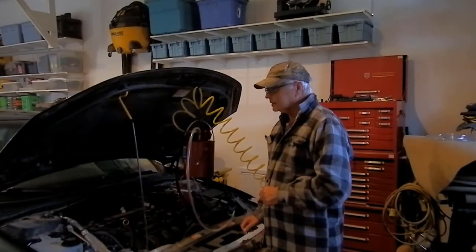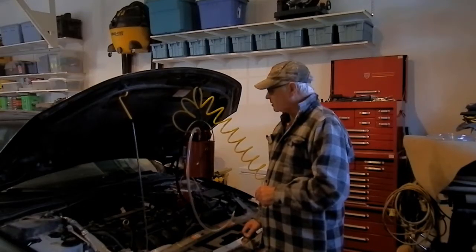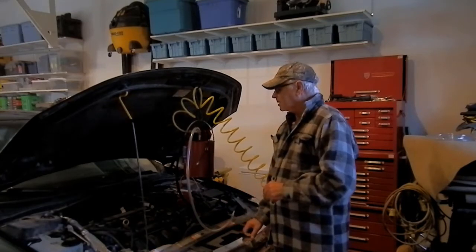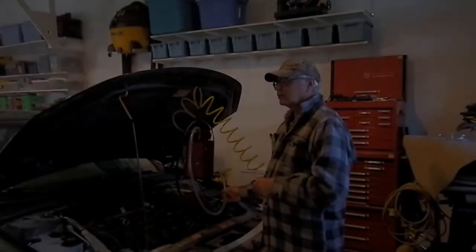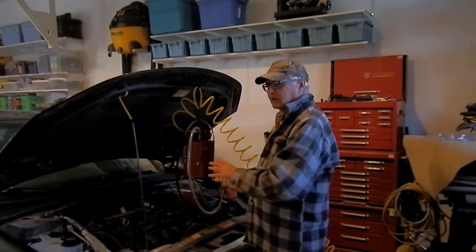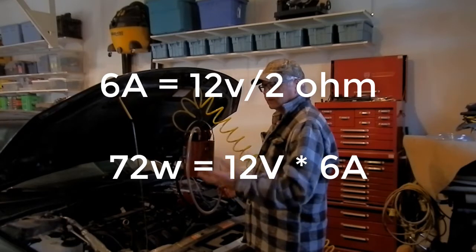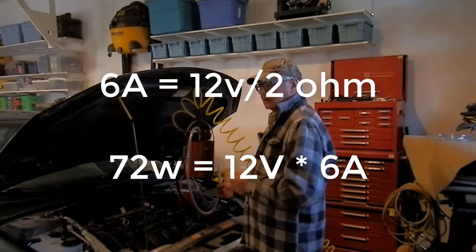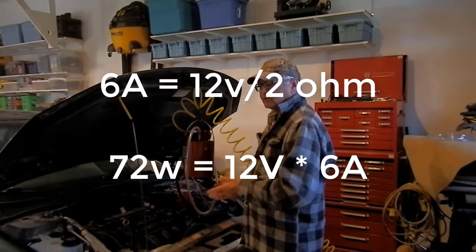Today I'm featuring another one of my builds, though it's not totally original. There are quite a few of these smoke leak detectors on the internet. I've taken what I think are some of the best ideas and added a few of my own. I stayed with about 72 watts of heating element. If you shoot for a resistance wire with two ohms at 12 volts nominal, you're going to draw six amps and that gives you 72 watts of heat.